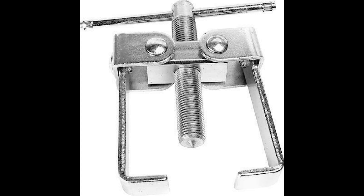First I tried a three-arm gear puller. The problem is it's not easy to get it to grab onto the non-drive side. The drive side is not so bad because you can hook it in a handful of places. So I bought a two-prong gear puller thinking that might actually be a better grip, but you can see the tool in the picture — it didn't work. It wasn't strong enough, and the big screw on the gear puller just didn't fit into the right position.